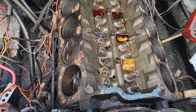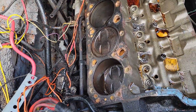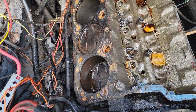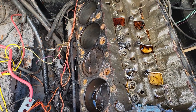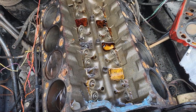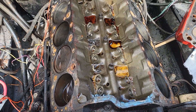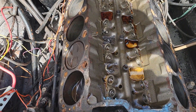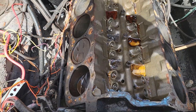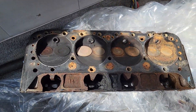I took out the head gasket and number two cylinder here. It sat for a little bit and got some rust damage in cylinder number two. I'm thinking there's a possibility that I could hone this out and reuse this short block. I'm gonna try.